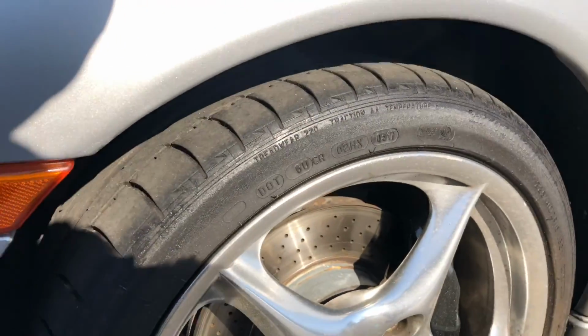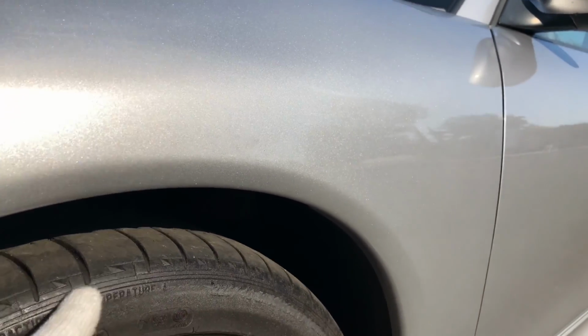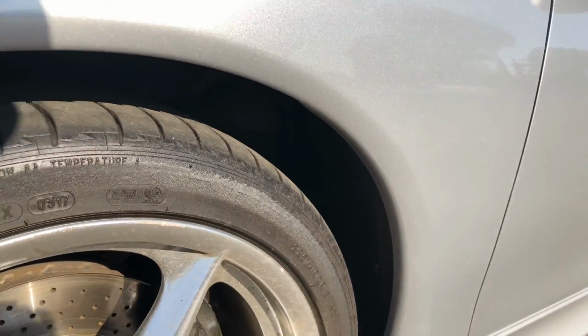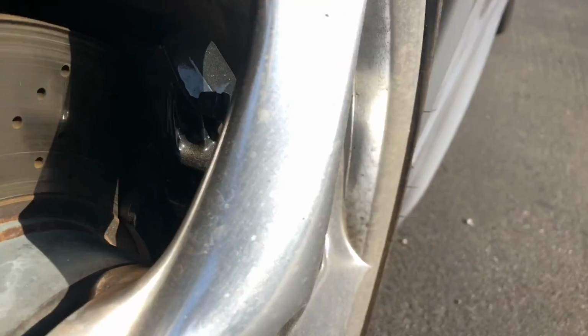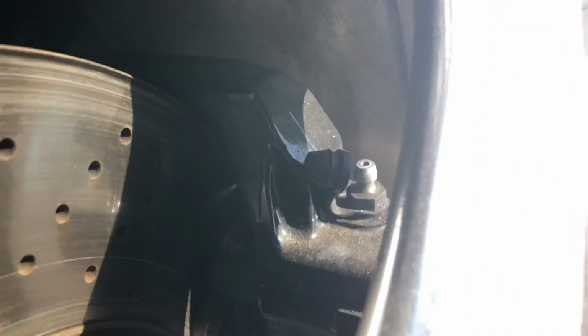Okay. Tires are low, right? And so low it looks like they ran it that way, because now you can see where the sidewall's been damaged. So this tire is no good. This would have to be replaced. It's a 225/40 ZR18. I don't even bother with the production date because the tire needs to be replaced now. Looking at the brake pads, they're about 3 millimeters, getting close to minimum specs where they should be replaced.